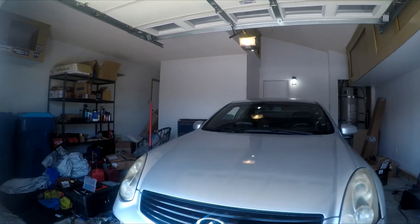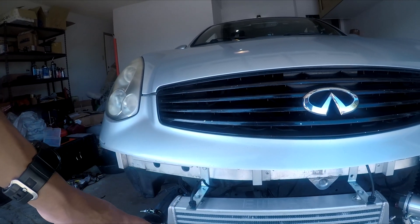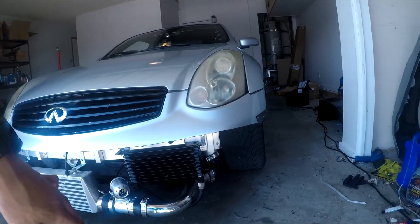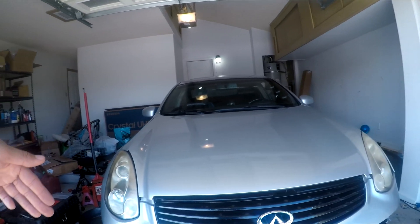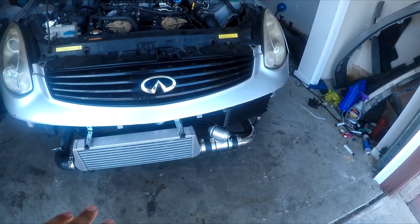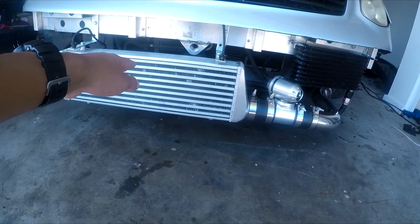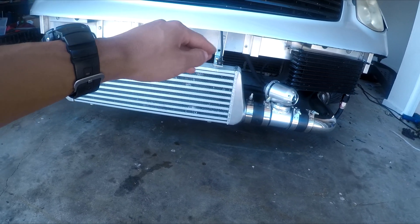You're also going to need to get that compressed air to the throttle body. This intercooler here is coming all the way from the turbo in the back. You need an intercooler because the turbocharger compresses air and compressed air gets really hot. This cools the air before it enters the engine — colder air is more dense, and if the air is too hot it's going to cause problems with pre-detonation. So you want the intake air as cool as possible. You have your hot side — the exhaust side where the turbo mounts — and your cold side where the turbo sends charge air into the engine. I do not recommend skipping the intercooler in any setup. I'm running an air-to-air intercooler; you can also do air-to-water, but that requires a separate water tank and pump, which is expensive and more complex.